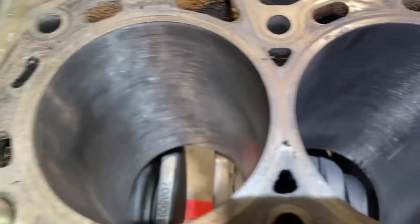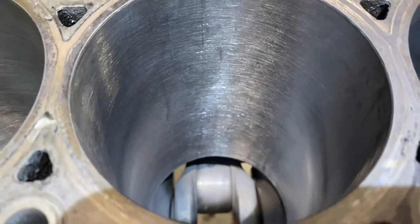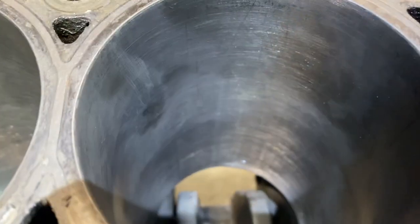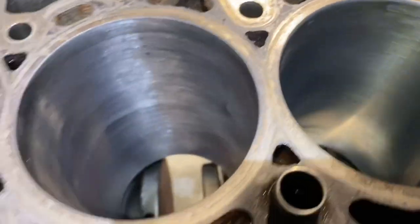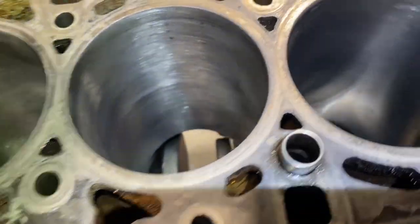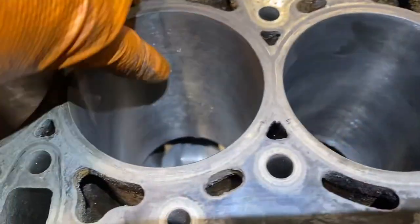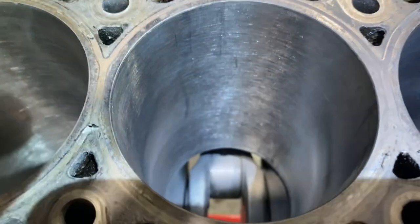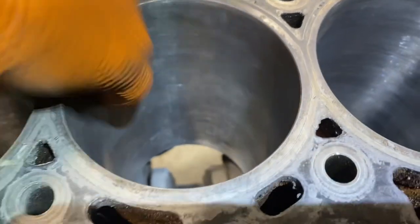Okay. I'm after honing all the cylinders where we had our scuffs, our score marks there, and just me with a cloth and stuff. It actually feels very good now, I have to say. Again, only thinners I put on a cloth here and just sent in to clean them up. And the two problem areas were these ones, and right now there was a little residue of aluminium stuck here on the side of that one, but it is gone, and as I said there, I don't want to go any harder on it. It is bang on both the ones that I had a question mark on.